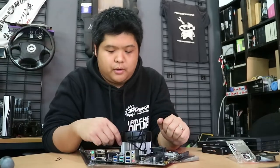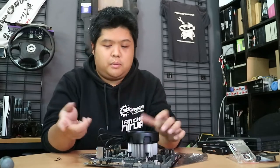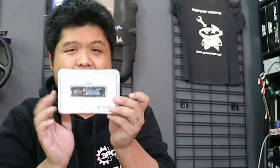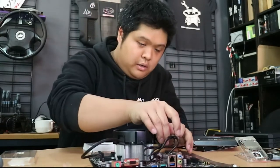It's probably fine. Going to neaten up some cables and then plug in everything else on the motherboard. Before we mount it in the case, we'll probably stop for lunch — but you don't need to know that. SSD: the little mount for the screw goes in first, then the SSD itself goes in.